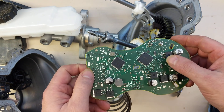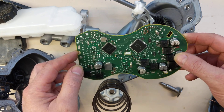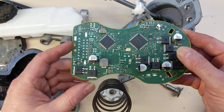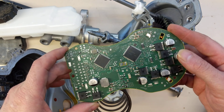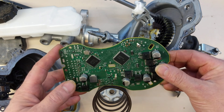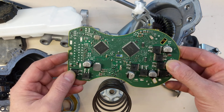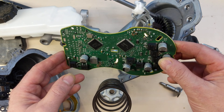I suspect that in the ECU there are two processors, probably because one is cross-checking the other for safety. They want to make sure this doesn't fail and slam on the brakes or fail to work, especially since this is being used in a safety-critical application. They want to make sure it's very robust. This probably has a lot of development in it, and it'll probably be one of the later things if Tesla ever takes it in-house, since they're assuming liability. So it'll probably be a while before Tesla builds their own iBooster.